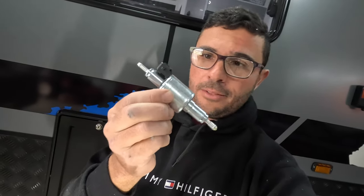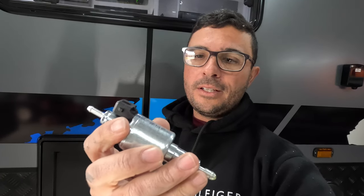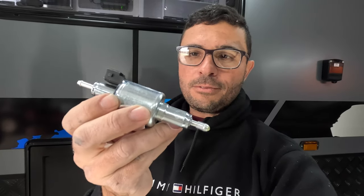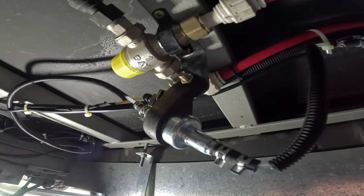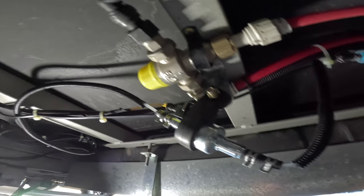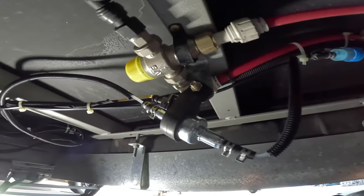Now for the fuel pump. I'm prepping it with two little rubber black hoses on either side with clamps, so when I get under there I can just slide it in. These pumps need to be mounted at about a 45-degree angle to prevent air bubbles — it's an actuator-type pump and the agitation can create bubbles. The fuel pump is now mounted using a little bracket off the chassis with an existing hole. It's at the correct angle and secured in its rubber mount, which should help minimise the clicking noise.